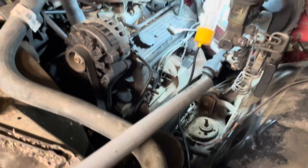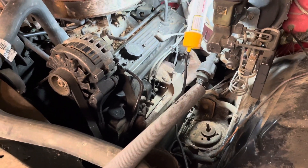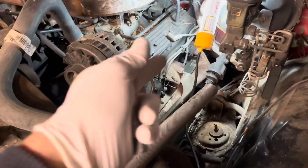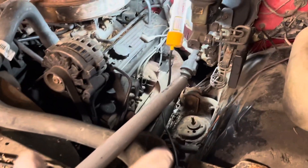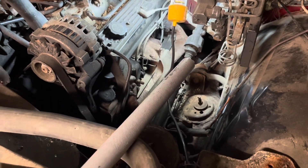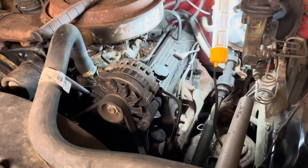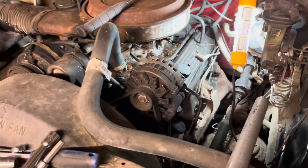Now I get to take out the rest of the spark plugs. What I might do is pop that extracted hole spark plug in with a brand new one, get the truck running, and heat that motor up - because I think a hot motor is better. Then I'll penetrate all those other spark plugs and I think they're going to come out no problem. That is my plan.